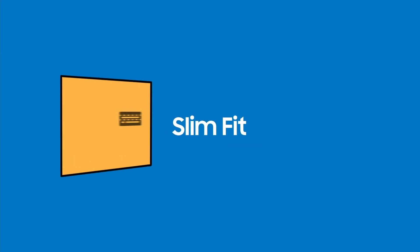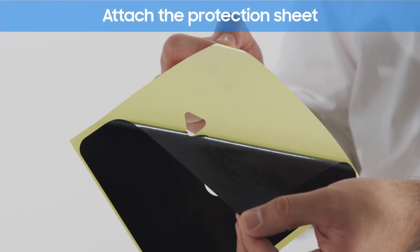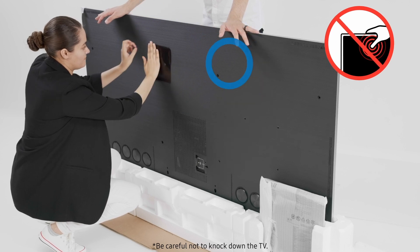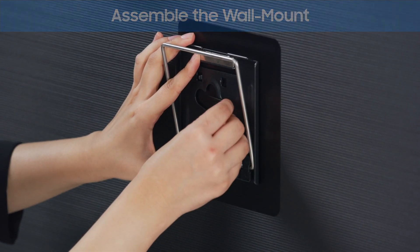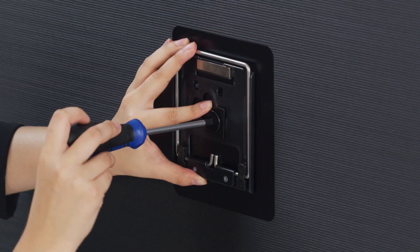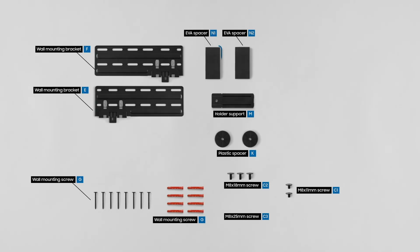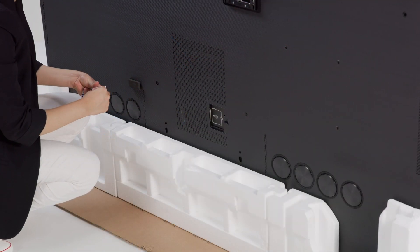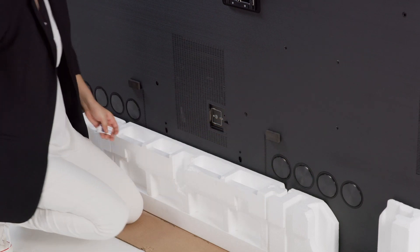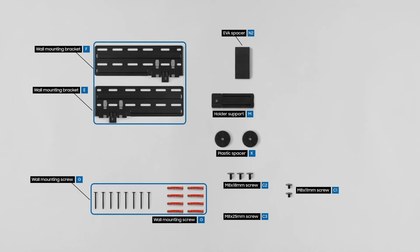For those who want the new TV to hang beautifully on your wall, we will show you how to mount your TV on the wall. Attach the sheet onto the designated mount positions on the TV. Place the square holder to the mount, then screw it on carefully. Adjust the wall mount so the screw is centered, and do the same to the other side. Attach the sponges onto the four corners of the TV. Connect the One Connect cable to the back of the TV — it gets tricky later if you don't do this first. Now let's move on to set up the wall mount brackets.